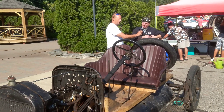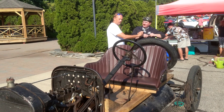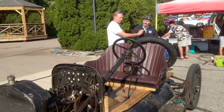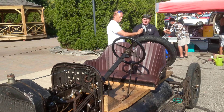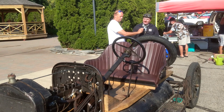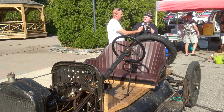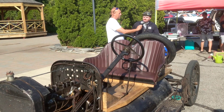The Chevy head — to be honest — is a cheap way of putting the speed on. Because there were period-correct overhead valve conversions available for Ford Model Ts, but they're very expensive. The cheap way of doing it, if you have access to a machine shop, is making it work naturally by putting your Chevrolet head on the Ford block.